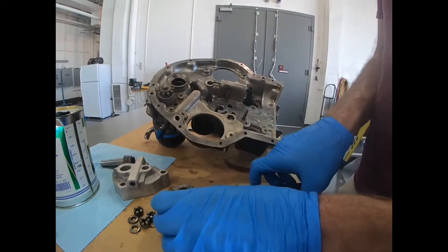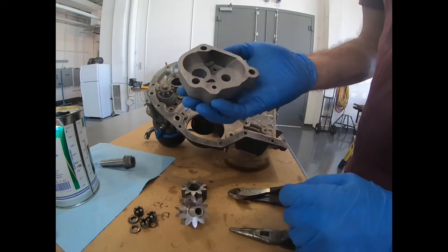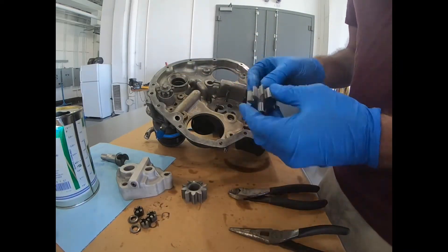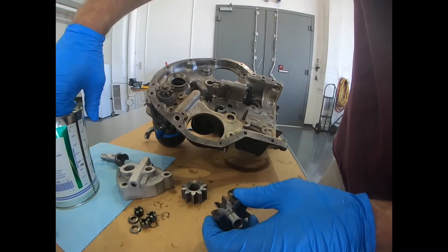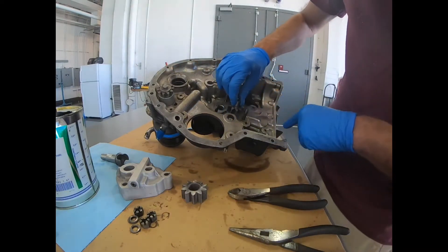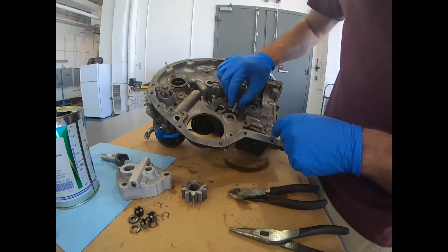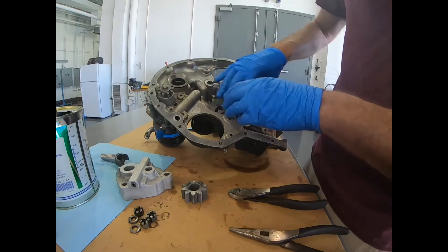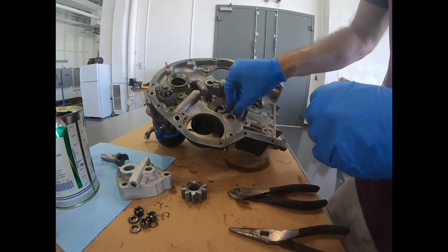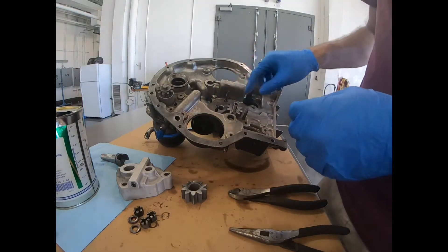Now that you have the oil pump disassembled, we have the new gears - nice shiny new gears. The housing's been cleaned and we did a brief visual inspection; no damage there. Before we install this, we need to put some pre-oil on it. The big concern with pre-oil on the oil pump is: if the oil pump is dry when we go to start it, the oil pump is responsible for sucking oil from the sump up into the housing to feed the rest of the engine. If this is dry, you run the risk of cavitating the oil pump and there won't be a good seal when this thing's spinning to actually draw and suck oil up into the housing. So we like to fill this cavity with a lot of pre-oil to keep the seals tight so when we go to spin it, it'll actually create a good suction force and pull oil up into the system.